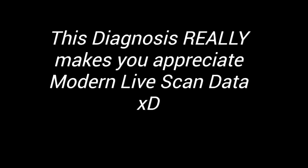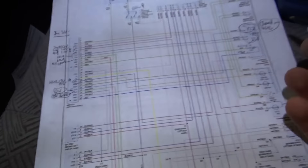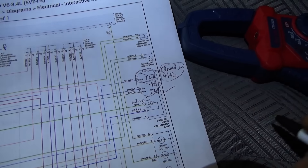The 2-wheel drive TL1 works. Let me double check TL2 and TL3, then we'll go into the truck. I don't have a good feeling about this. I'm messing with the transfer case shift motor. You can't just take it off - the whole shaft goes into the transfer case and moves shift forks.